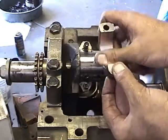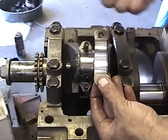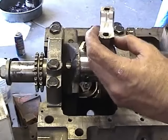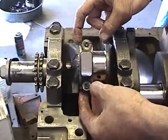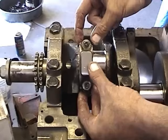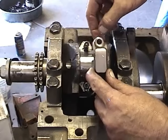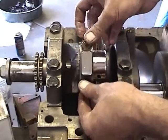Next we're going to take our rod cap. As you can see, there's a little keeper lock tab here and the same on the other side. All we're going to do is put these on the same side — which is upward on this one — flip it over like that. That way they will lock against each other and they won't spin the bearing. We'll put some assembly lube on here and put the bearing cap on. Another dead giveaway: see those little corner tabs on the bearing cap? They usually stick out and are used to splash oil around on both outer sides of your rod bearing. You're going to have a squared-off tab facing outward on each side — they're never going to be touching in the middle. Line up your tabs and get the bearing set on here.